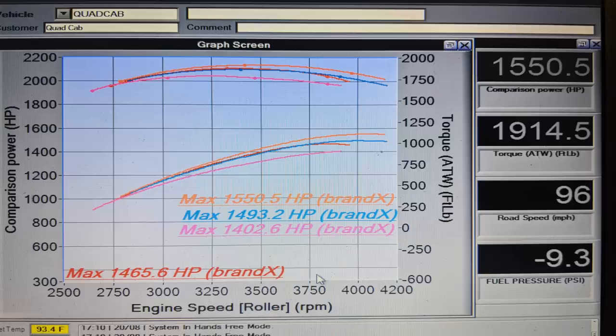1,550 horsepower and 1,930 foot pounds of torque at 2,000 microseconds, with boost up around 117 pounds. I know we're running away on drive pressure without the manifold charger keeping up, so we're going to call it quits for today. I'm going to dial this back to 1,280 horsepower — what we want is 10.5 seconds in the quarter mile or a 6.70 in the eighth. This tells us that a bigger injector with correct body mods delivering fuel faster will lower your boost numbers, lower your EGTs, and make more power because of that faster fuel delivery. Good injectors are very critical to a good running setup.